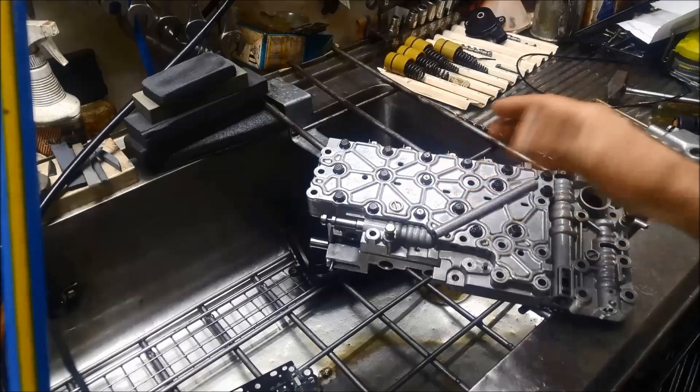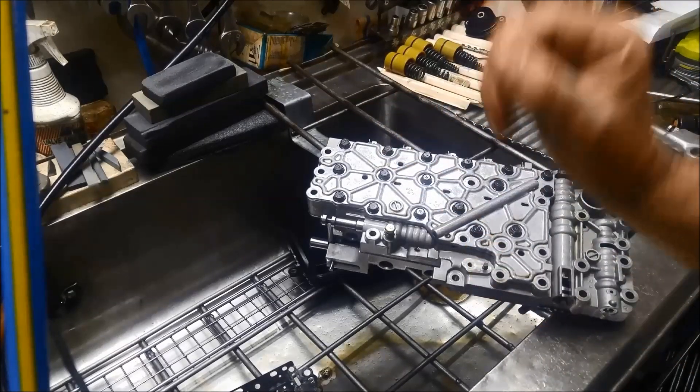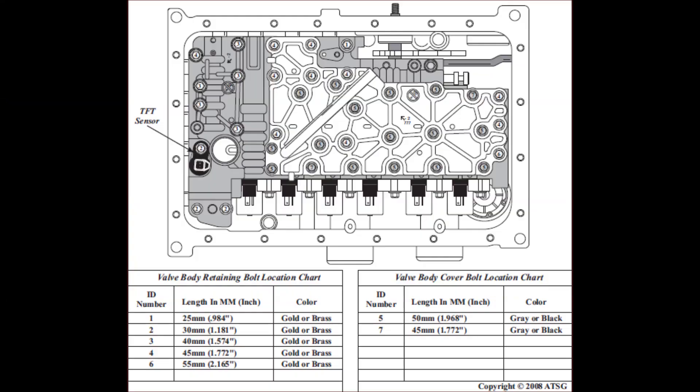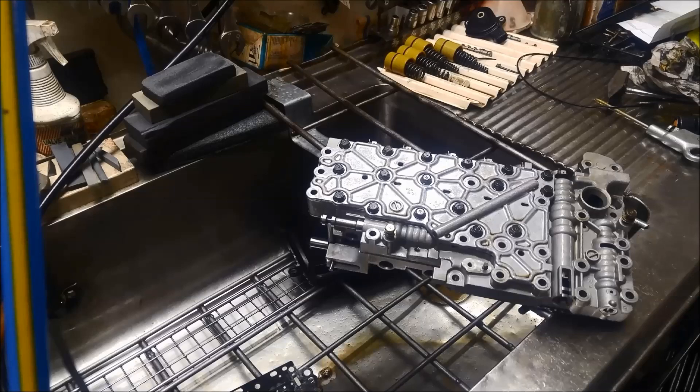When you're fitting it you need to sort of balance it on top of the valve body and lift it up — you can find all that in another video where I've done the same thing. I hope that's helped — it's a bit of an improvement on your V5A51 transmission. Like I mentioned, the torque converter control valve improvement will handle a few other Mitsubishi, Kia and Hyundai vehicles. Worth checking it out to get a bit more life out of your transmission. Don't forget to like and subscribe, and buy me a beer if any of this information has helped. Thank you for watching.